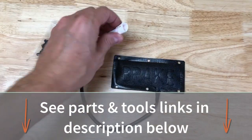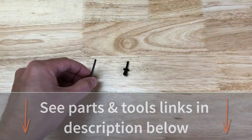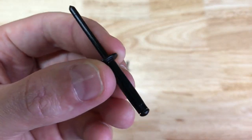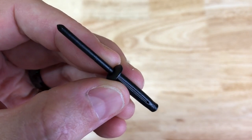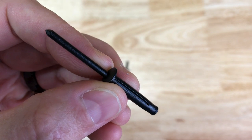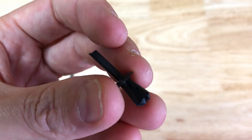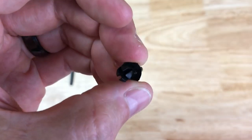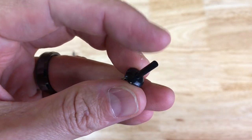You're probably wondering why so few tools. We'll get into that by looking at what's included in our brake pad. First, we have our brake pad and the included pack of rivets. There are two styles of rivets included. Both require drilling a 3/16 inch hole through the rubber pedal cover and the metal behind. This style requires a rivet gun and is going to be more secure. This one gets pushed through on one end and then you hammer in the pin to make it flush.